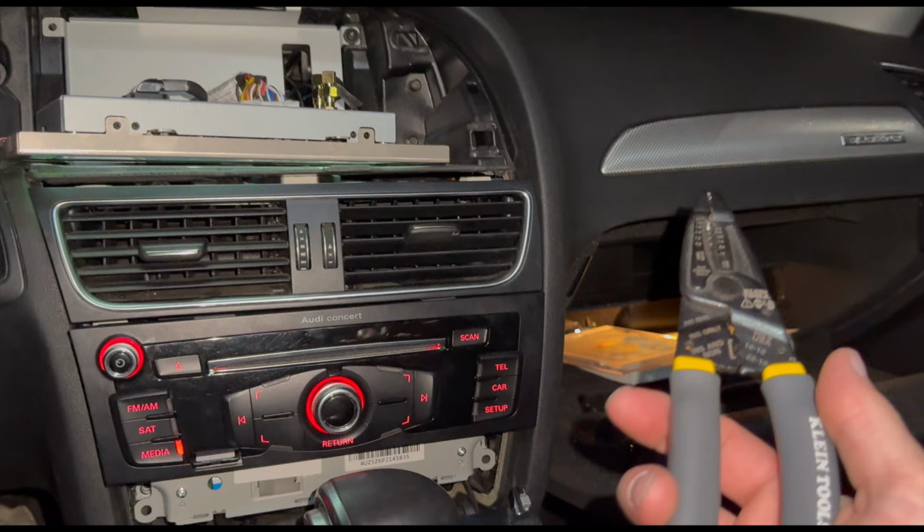So if you pull on the bottom, it's not going to move at all, and you just basically need to get one of those top screws in. I was only able to get one in, and then you'll be able to move the screen, and you'll see it's very solid. But yeah, the wires and cables behind, those are your biggest obstacle to getting this to sit flush. And remember that airbag wire, you're going to have to be smart about how you're routing it. I believe I routed it below the screen. You cannot route it beside the screen, because if you route it on the side, it's not going to sit flush. So it has to be routed below the screen.